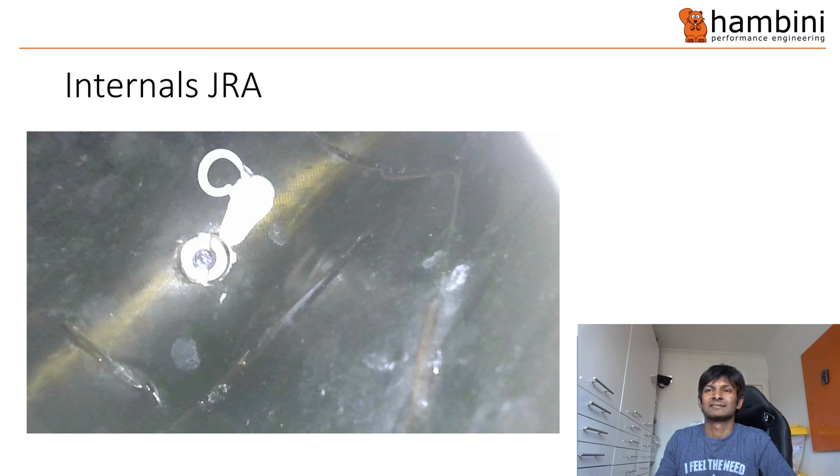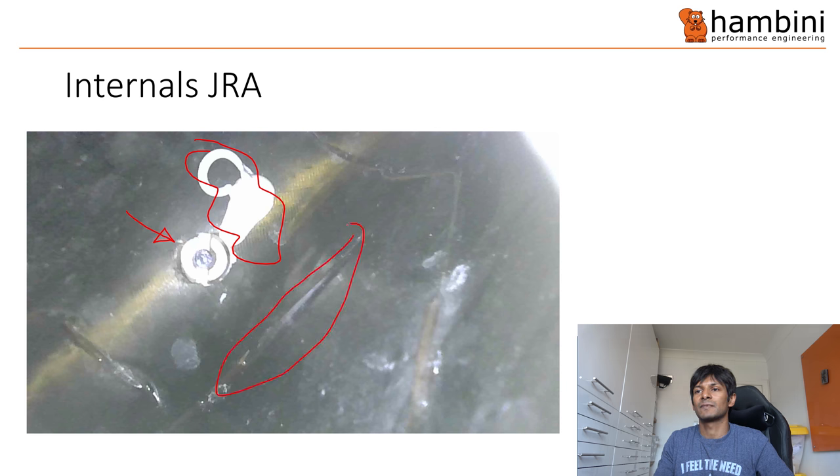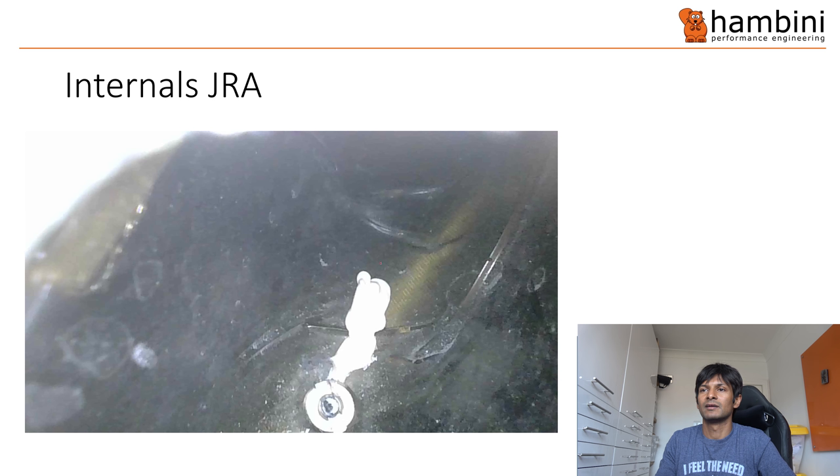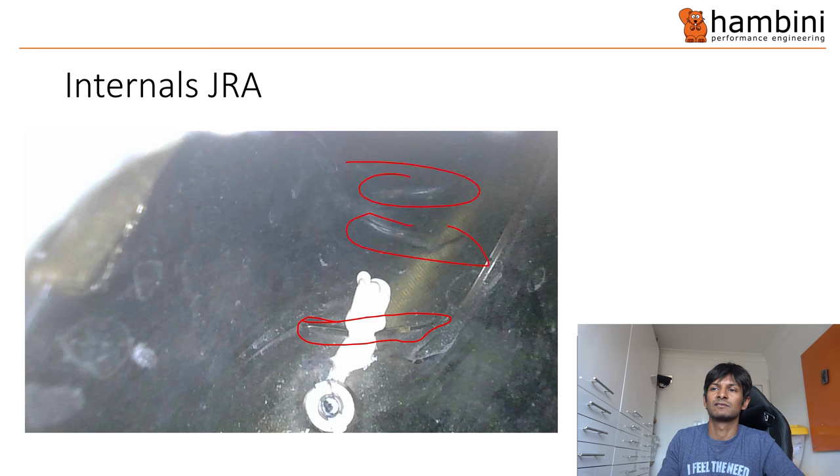The internals — if you're not familiar with this, this is a nipple, and this white stuff here looks like grease. A lot of people said in some of my videos it looks like resin pooling. There is a technique to check for resin pooling — that's to look at the fibres and see if the orientation changes, which is what happens there. It's quite obvious here. So that is where a layer has tented, effectively. Towards the trailing edge of the rim, that's not great.